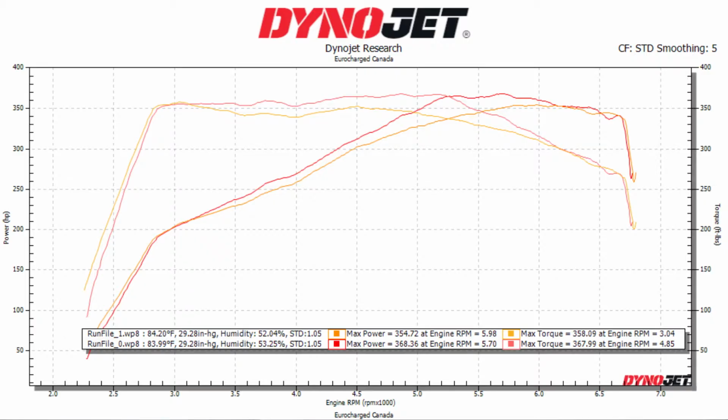Some might think that it's not a huge horsepower gain for the risk you take, because a lot of people told me I was brave for doing a stack tune. However, it's not just about the peak numbers. If you look through the graphs, there is quite a huge jump in the power underneath the curve comparing both of them. At some points in the chart, it's even as big as a 40 wheel horsepower difference. So overall for drivability, I think the Unitronic Stage 2 with the JB4 stack was a fantastic setup. It would probably be more than enough power for most people.